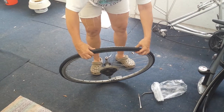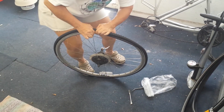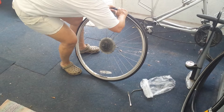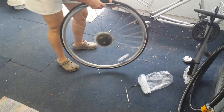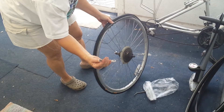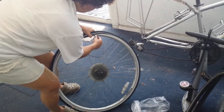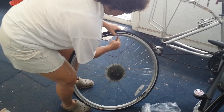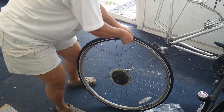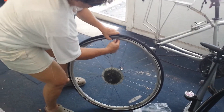I almost have just a small space left. Don't leave the part by the inner tube nipple to last, because that's got the space taken up by the nipple. I think I'm going to need to go ahead and use my tool. So I take my tire iron, the flat end, and I'm just going to work it over the edge — a little bit on each side. It does have a little curve, so use the curve so you can get to the edge and it will slide over, then work it out. Only take a small portion, like an inch or two, and it's easier.